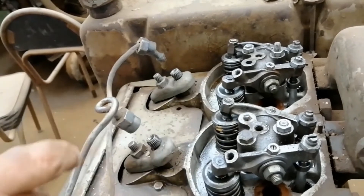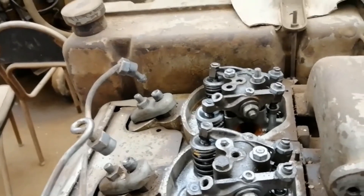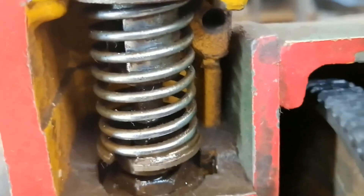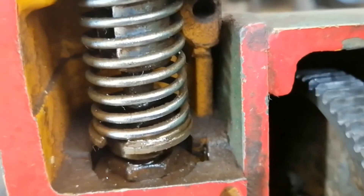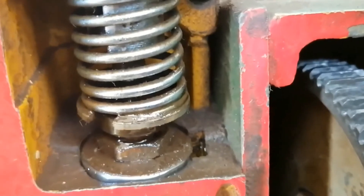When the injection plunger comes into position — when the straight part aligns — at that moment both valves are closed. So in this period, this time, we can adjust both valves, just like another method.